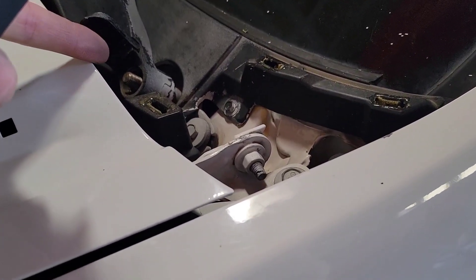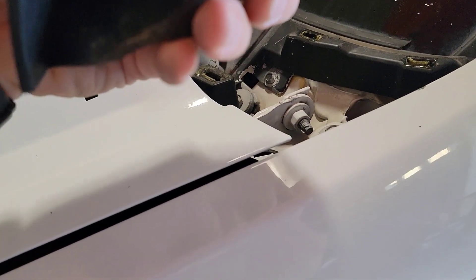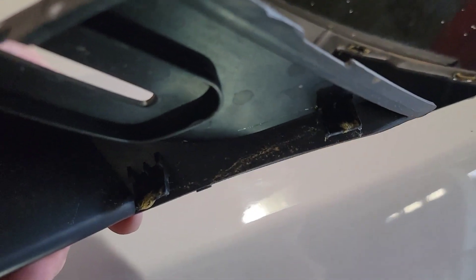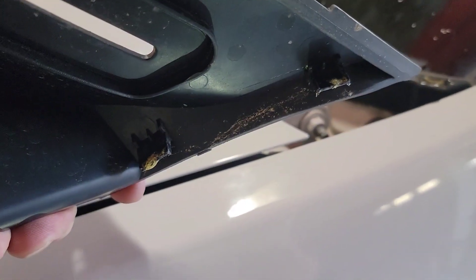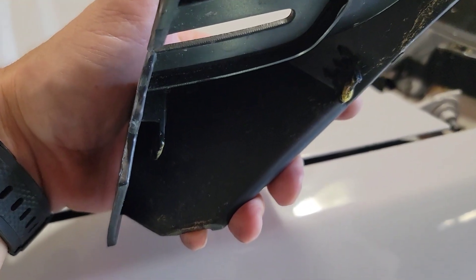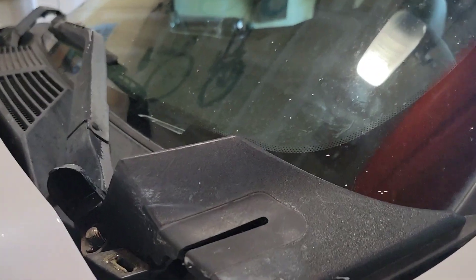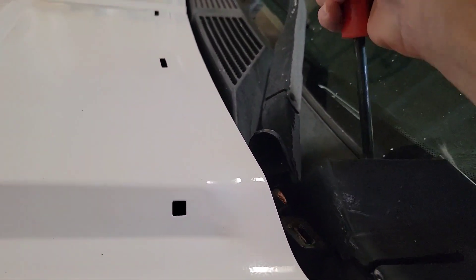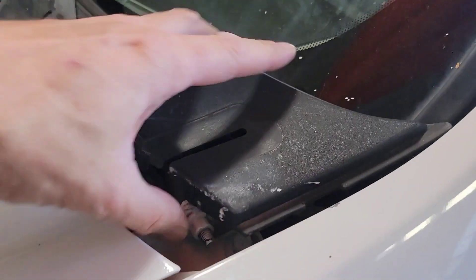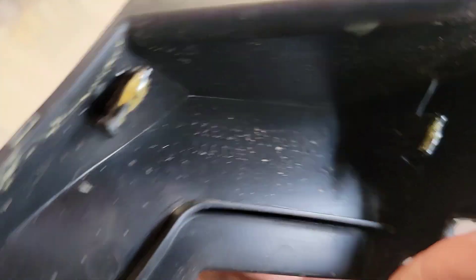Once we get the nuts off there, these little plastic rubbery-looking panels are just on by little spring clips — or were, in this circumstance. This is where I can tell somebody's taken this cowling off before, maybe for a windshield. They may have lost the clips or whatever. But if you order new ones, it may not come with clips, so just keep that in mind — you may have to reuse those. We're going to bring out the handy-dandy pry tool. I love this thing — I'll put a link in the description. Pop it up, it basically comes up, then set it aside.